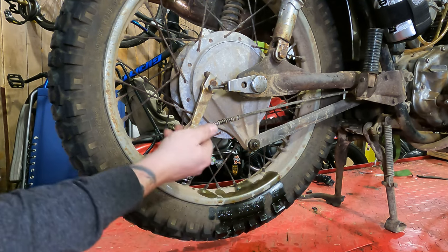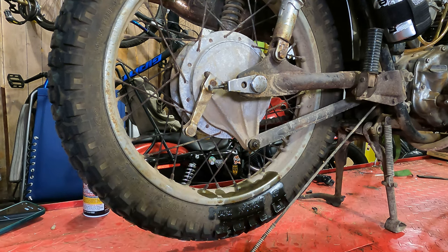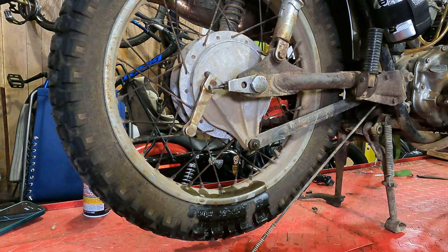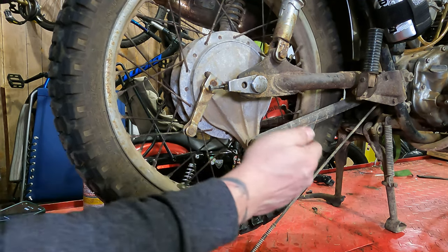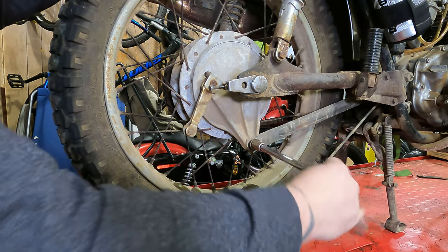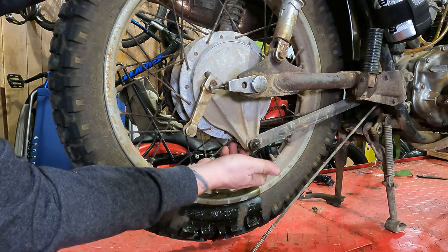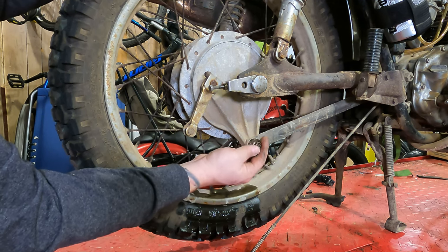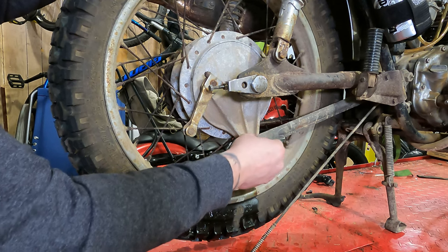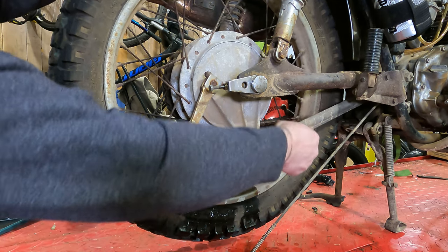Take your specialty nut, set it off to the side, and let your rod sit down there. Now to remove the brake strut — there should be a cotter pin in this, though who knows where this one went. Take a 12-millimeter socket and lefty-loosey that off of there. This bolt has a head that fits into the back of the strut so we don't have to put a wrench on there — we can just undo the nut. Take the washer and rubber washer off, then pull the strut off.